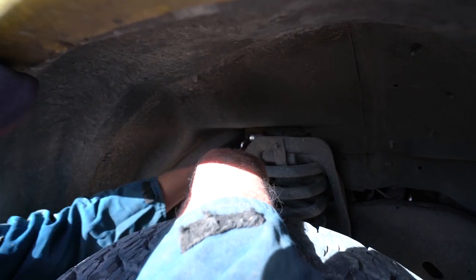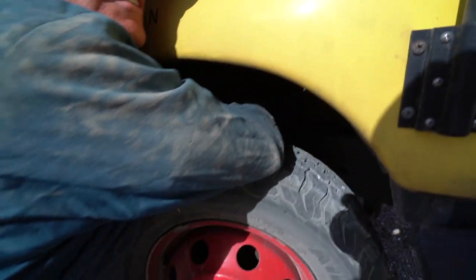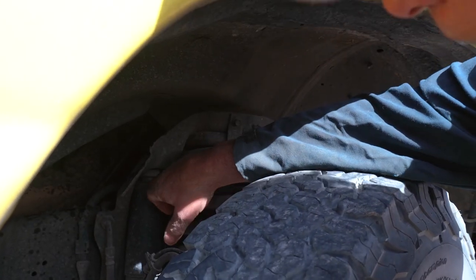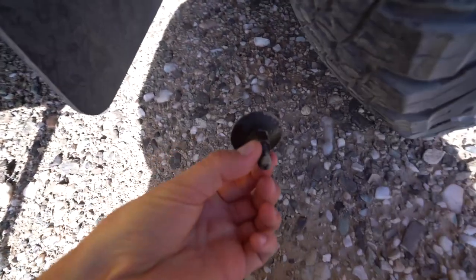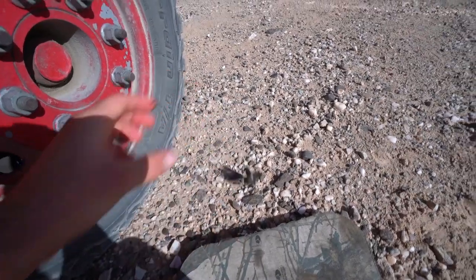Just so you guys know, this is a tight squeeze over here. We've got a pro and we've got an amateur. What do you got to do to get a shock off? Well, the Chevy you're alright because it didn't come down with a socket on an extension to break it off. But this Ford's got the wheel well there, so you can't do it. You have to take this one off. We're basically putting the ratchet on there. It's got a nut here — it's like a bolt — so it makes it pretty easy, really. Badge was ratcheting the top of the shock off, and he said that with old shocks it's impossible to get them off. This part always breaks — and it did indeed break off.